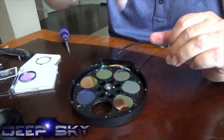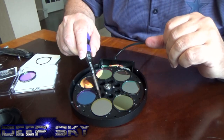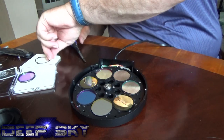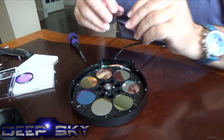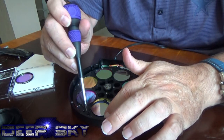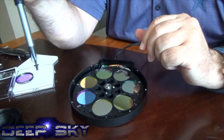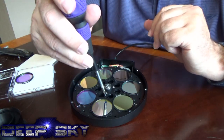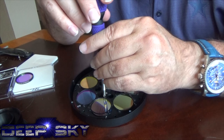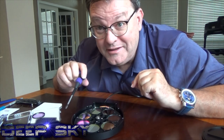We'll take the filter and put it in place right there. Make sure that's in there. We'll put the clamp on — it's made of plastic. Trying not to touch my filter while I do this. Fortunately, I'm using a magnetic screw holder, so this is going to hold it in place. You don't need to turn these very tight at all — just make basic contact and you're good. That's it. I've got the filter in place now. I'll go ahead and screw on the back and then I'll show you some results.